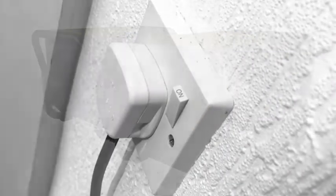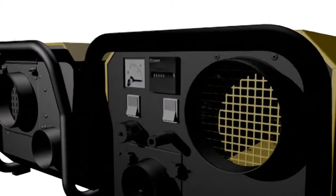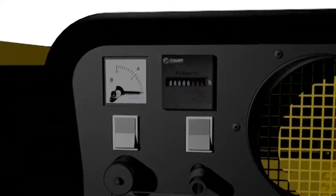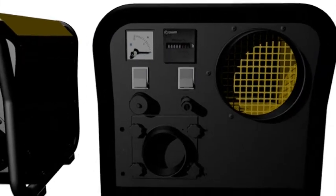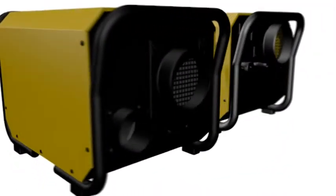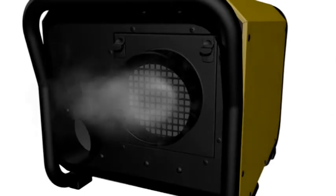Ammeter shows amps consumed in operation and allows calculation of power consumption of the unit. Triple safety self-regulating components ensure the dehumidifiers will never overheat, so they're safe to use 24/7. Power automatically adjusts to any ducting added to maximize performance and energy efficiency. Hour run timer shows the number of hours in operation to calculate both energy costs and prompt any cleaning.